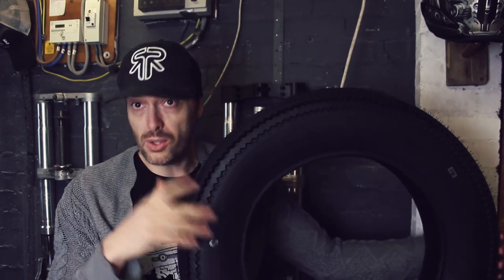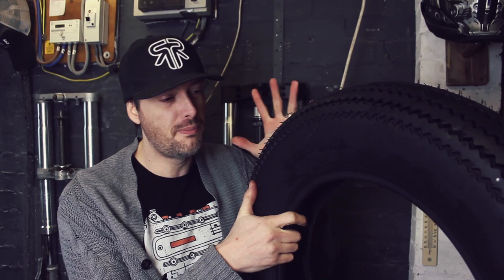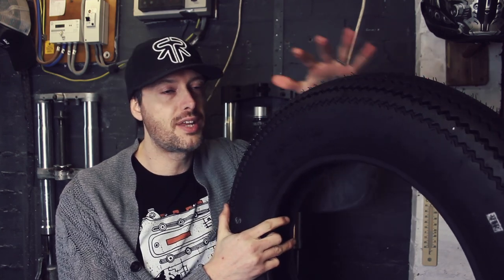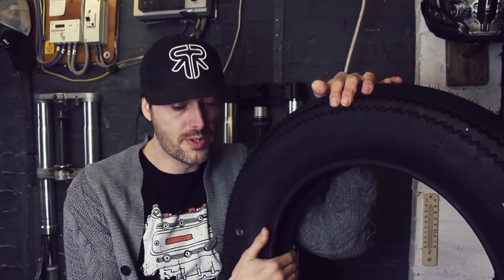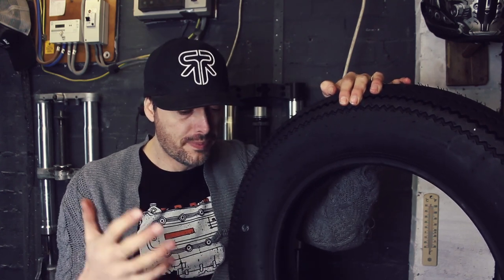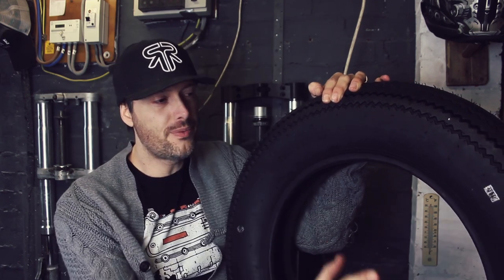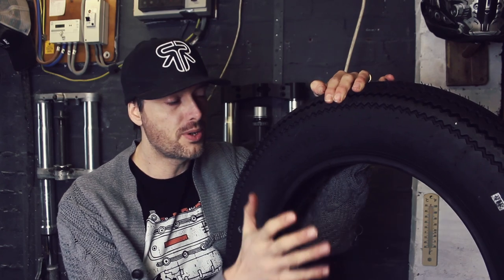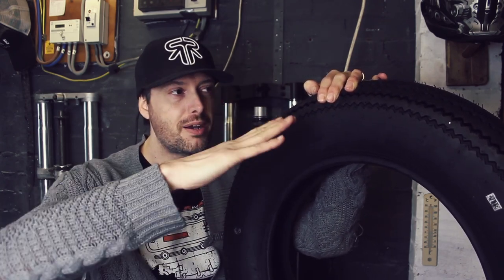I am excited to put these on, but looking at them compared to the existing rim and tyre — this is a much bigger tyre. That profile will take the back of the Mongrel so much higher. I'm going to have to possibly rethink how I'm going to do the swing arm — whether I'm going to extend it a little bit. If I need to extend the swing arm a bit further out I can do that. I'm not worried about the hoop; I'm worried about the height. Where we've positioned the shocks, it might need to change.